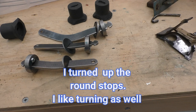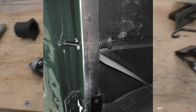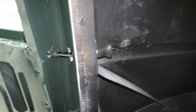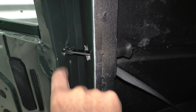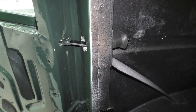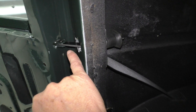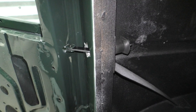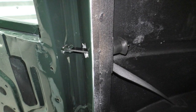Here we are in the car - this is one of the rear doors and you can see my check strap with the rubber buffer on one side, and here is where it is attached to the door. I've just got a little pin in there at the moment - actually a rivet. Originally this was riveted, with a rivet that bound in that bracket area. I'm not so keen on that idea because then the only way you can get it out is to drill the rivet out. So instead I'm going to machine a little stainless steel pin with a little groove in it for a spring circlip as an alternative way of fastening it.